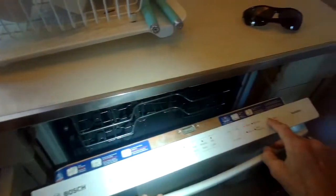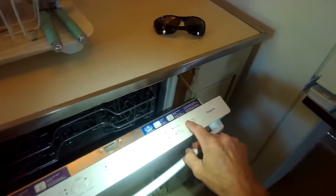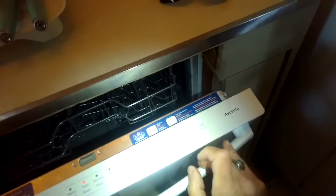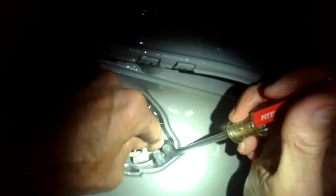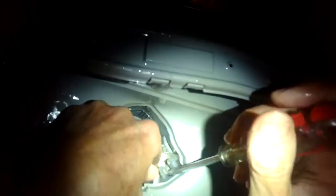I'm going to press that for three seconds or more to create a drain cycle and close it to see if it's any better. I'm going to pull that little part out — that impeller cover — and take my screwdriver and just spin that little propeller thing down there, that impeller, to make sure it can move easily. Sometimes a little piece of glass or something will get caught down there and prevent that impeller from moving fast enough. But it looks good, so I'll go ahead and lock that white plastic piece back in and put the drain cover back in.